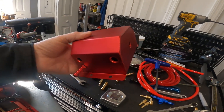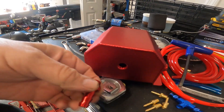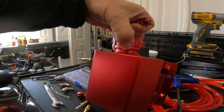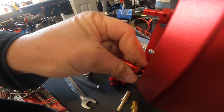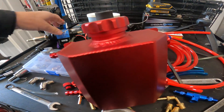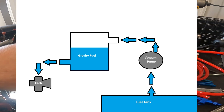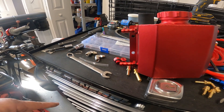I've got my tank and I kind of like it — it's got ports everywhere. All these fittings are all the same size and they all move around, so I can have fuel come in high and exit low, or exit on the bottom. I should be able to get it airtight — I think it has to be airtight. Otherwise the pump will just pump gas and it'll flow out the top or somewhere else. The idea is we'll pump fuel into this thing with the vacuum pump, pump it in up high so it can't drain back into the tank, and then use this to let it gravity feed into the carburetor.